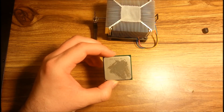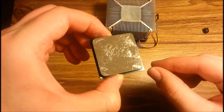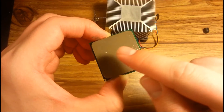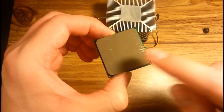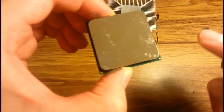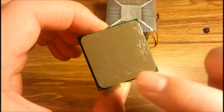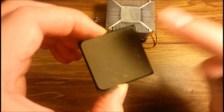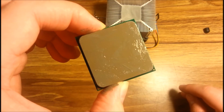Keep spreading until you've got it completely covered. In different lighting angles you might see lighter or darker spots, but that's just the lighting — just make sure you cover all areas. There may be small little holes or pockets, and you just want to smooth those over so that the thermal paste is completely spread evenly all over the CPU.